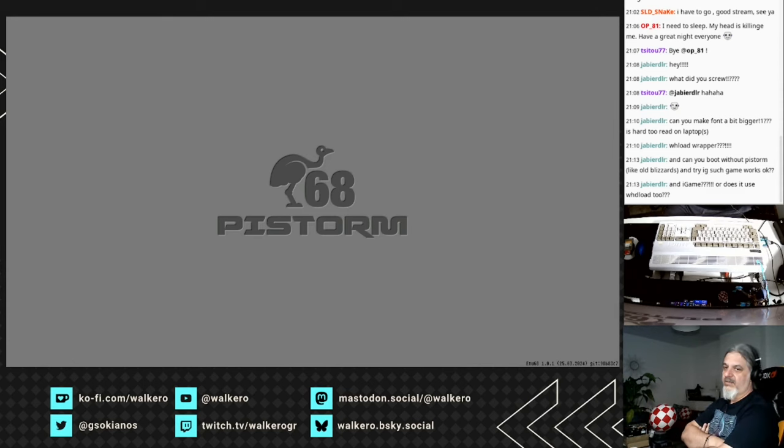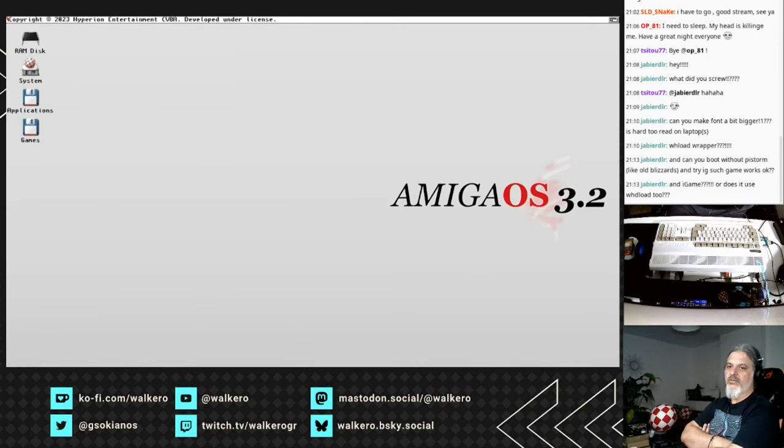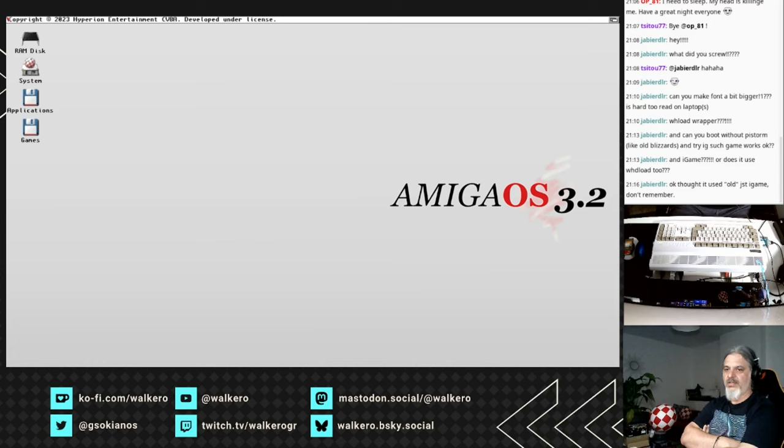iGame is a front end for WHDLoad, so it runs the game with WHDLoad. You can't boot without PiStorm because it replaces the CPU. It works like an accelerator, right? An O40. As much as I know, because you also load the Kickstart from the PiStorm, if you disable it, you are going to have a problem. Also, the hard disks are on PiStorm.